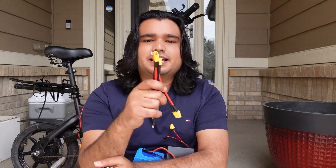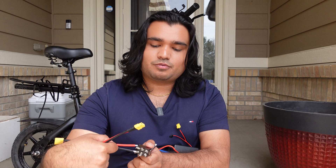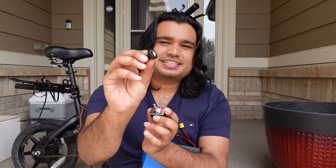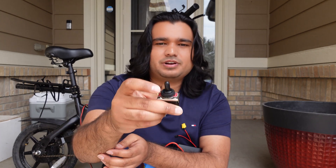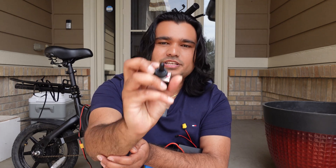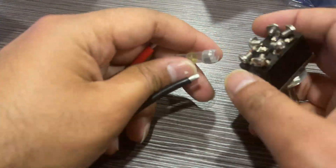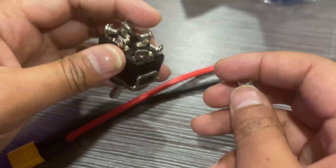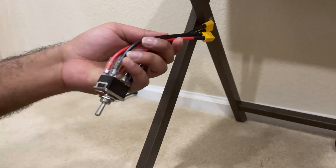You can purchase these connectors on Amazon as well. Connect your male connection to the center port — if you run the red wire this way, you have to connect all the red wires consistently on that side. Make sure polarity is consistent across all wires. The switch comes with a waterproof casing that tightens and acts as a layer of protection. I wouldn't fully trust it in water — don't ride this bike in rain — but it does add some security. I soldered my wires using heat-shrink solder connectors from my thumb throttle video; I just had to cut them to fit, no traditional soldering needed, and the connections are tight.